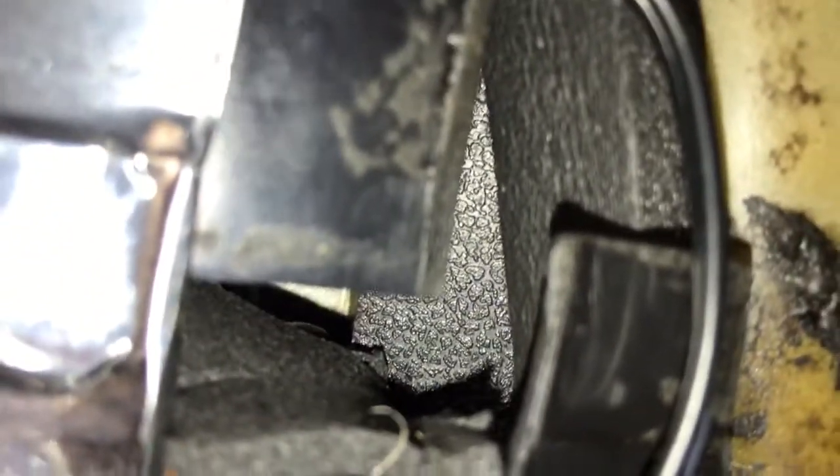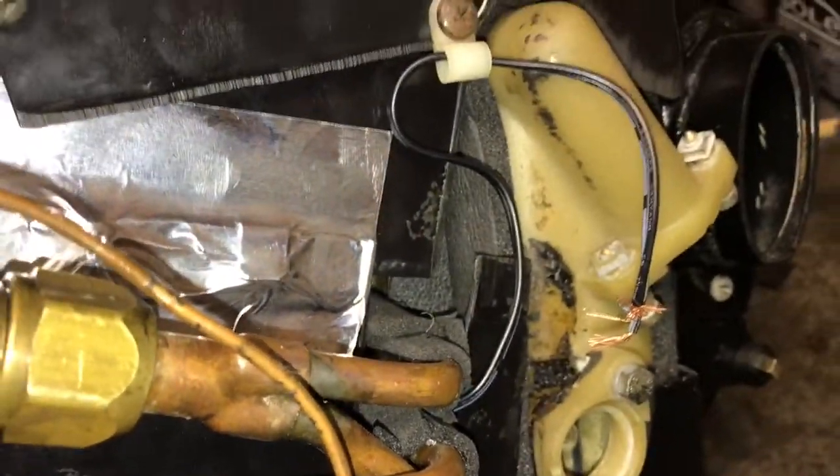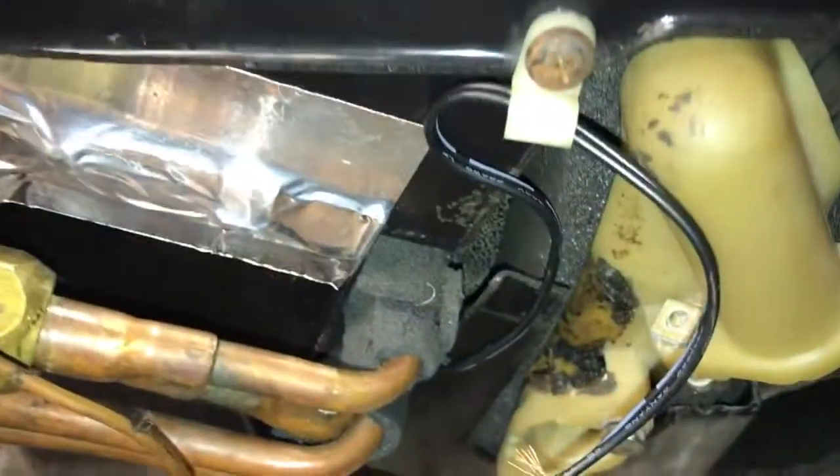You can see the little lead for the evaporator switch there. I also put a little plastic divider — you can barely see it — in that little triangular space between the heater core and the evaporator, so that air doesn't just piss out of there. You need the pressure in order to get velocity out of the defrost and the other vents. If you're losing pressure through a big gaping hole, it's not good. So I sealed that up and used lots of aluminum foil tape all over this thing.